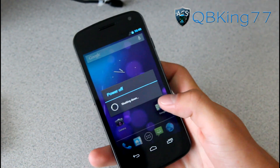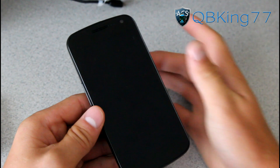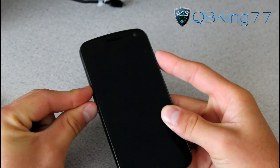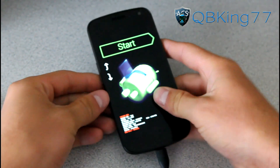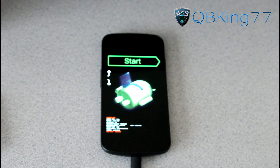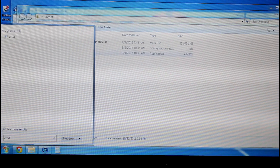You do need to make sure you have the SDK tools installed on your PC. If you do not, I will post a link in the description on how to set up the SDK tools. Press volume up, volume down, and power button all at the same time to get into the boot loader. Once in the boot loader, plug your phone into your PC and let drivers install if needed. Then open a command prompt — hit start, type CMD, and hit enter.